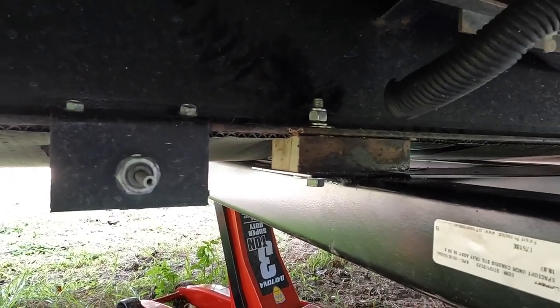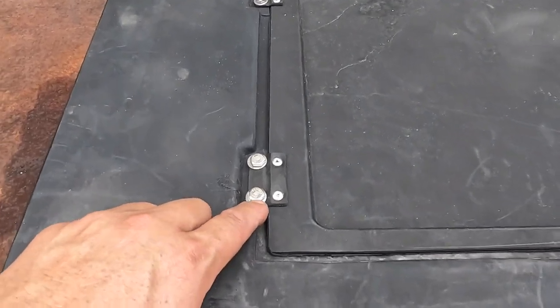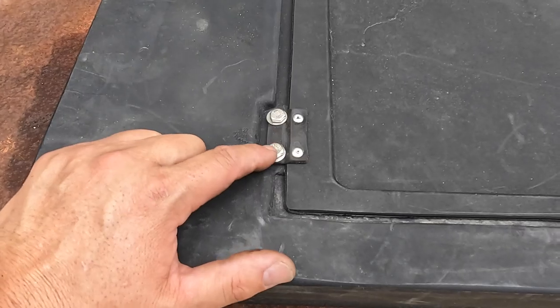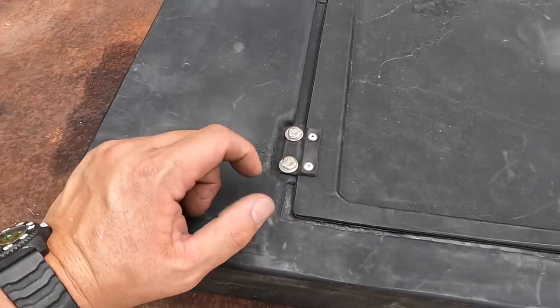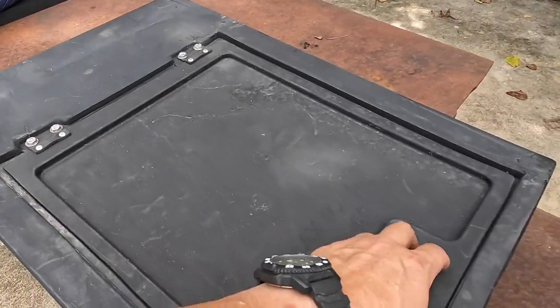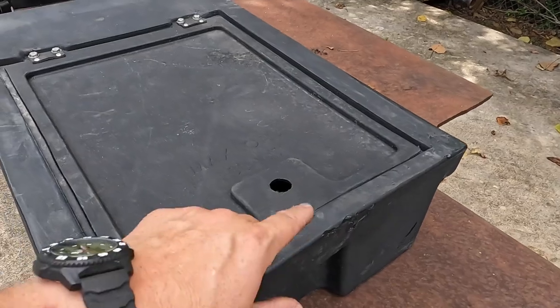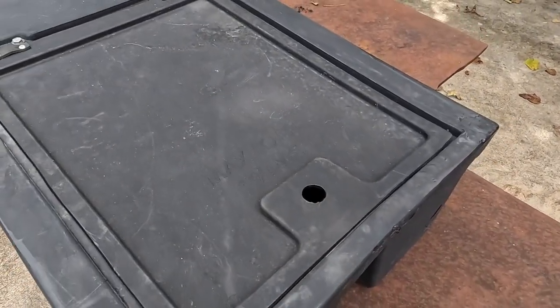That's what we used. I went ahead and got the other storage compartment fixed, and all I did was just drill out the four pop rivets. I had some 1/4-inch stainless steel hardware in the shop I used, some bolts, flat washers, and nylock nuts. So I got that fixed up so that our container is going to work the way it's supposed to. This is the one that got a little bit bent, so it's got a tight fit there, but you can shove it down in there.